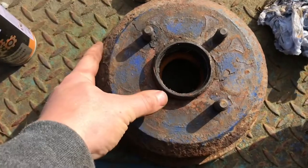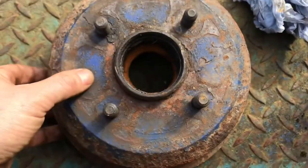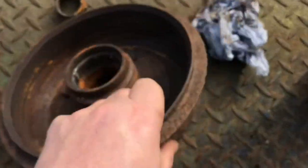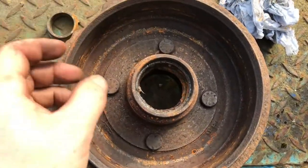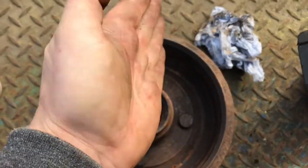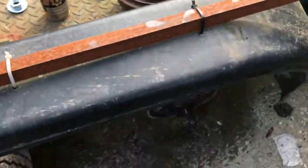So there are the bits of it — this is the old hub. There's actually a hairline crack in it just along there. Basically the hub is also damaged. We knocked out the bearings and they came out in bits as well. The inside one was actually okay, but the outside one was completely destroyed and the wheel hub was all over the place. There was no saving it.